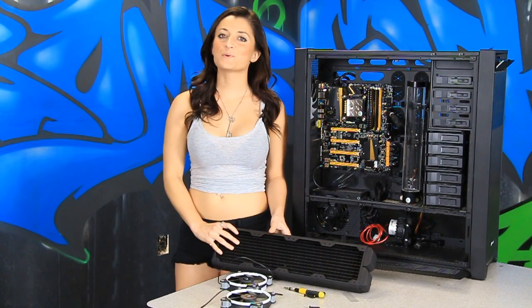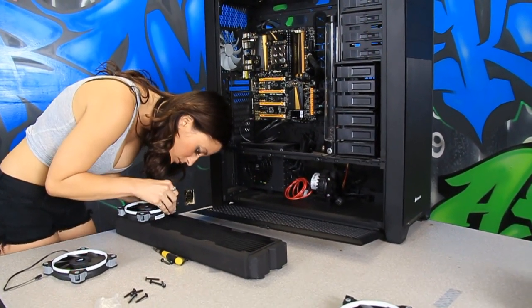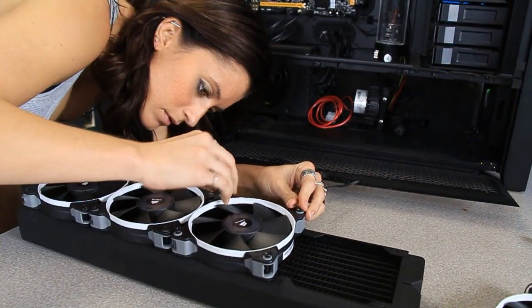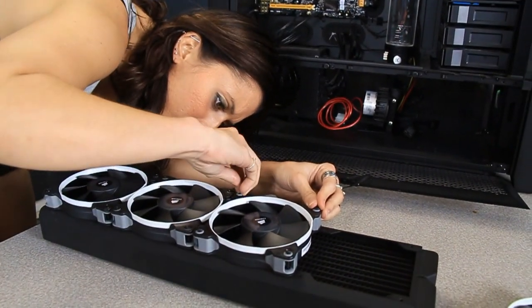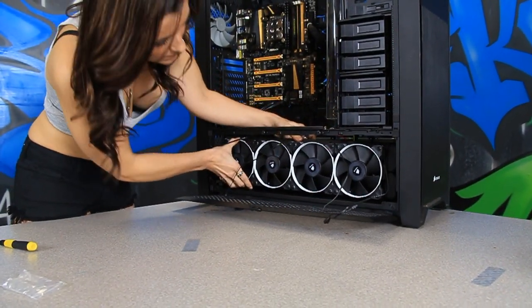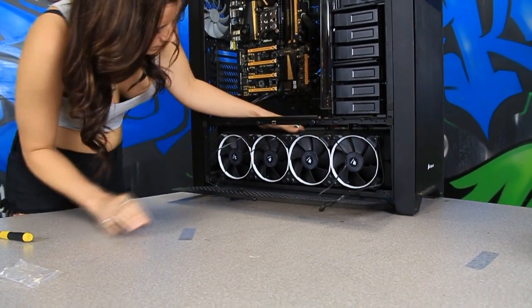Now on to step four — the cooling power. We went with the Black Ice SR1480 quad radiator. We're going to mount the fans on the outside, just because it's going to look pretty damn awesome. This will push air into the case, over the radiator, and we're going to exhaust it right out the back. Remember, you want to be careful to make sure you're using the right screws, otherwise you can damage some radiators. Now we aren't going to fully mount the radiator right now, because if we need to make any quick adjustment on the fly, unscrewing all 16 mounts is going to take a minute. We'll do the final mount on step 10.